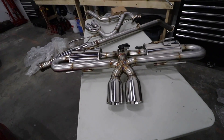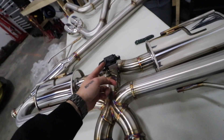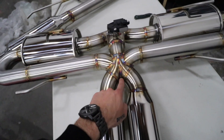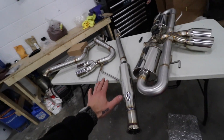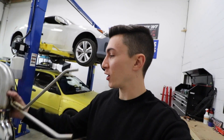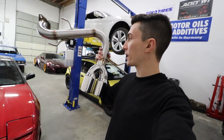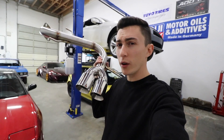This is insane. This is honestly the most insane exhaust system I have ever actually seen. This one is also valved — it looks like it's probably a better valve system than the Karma one was. Exhaust could go straight through here and out these two when it's open, and when it's closed they just kind of go through the sides. This is a full, essentially header-back system. It's something really incredible that DSG has done. Even if you just want to do the bare minimum, you need a body kit and you need an exhaust system that's center exit. DSG is producing this — essentially just an axle back — that should bolt up to pretty much any aftermarket mid pipe or even an OEM mid pipe.